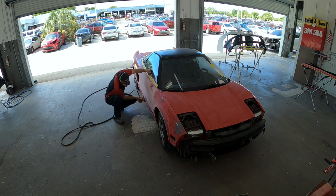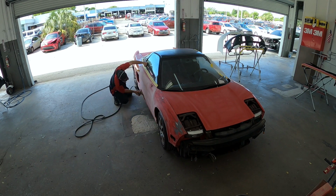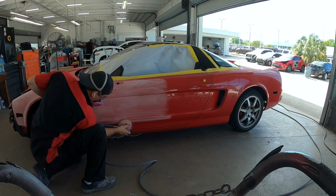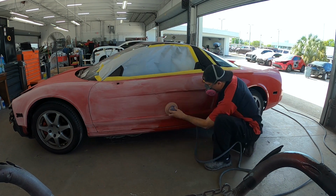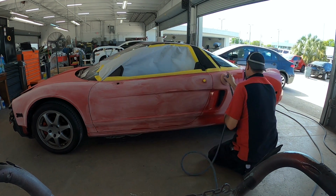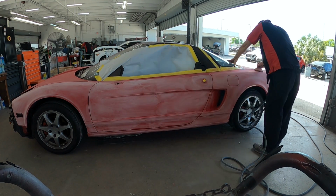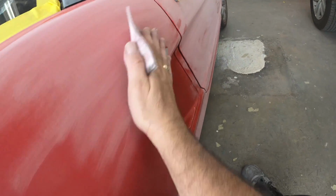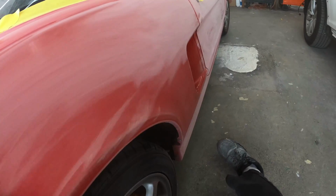Now, over onto the doors, we're good. They weren't in bad condition. There was no dead paint on the lower half of the door. So what you can do is take your 320 to 400 and just give that a sand, which you can see here. Now, on this particular car, I would say about 50% of the car is the door. You know, they have those nice long doors. I love this body style of this actual car.